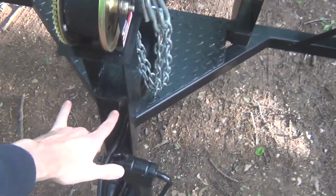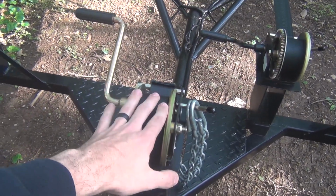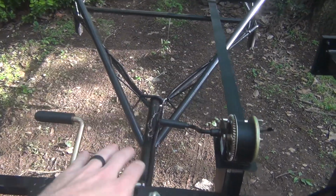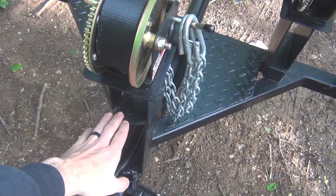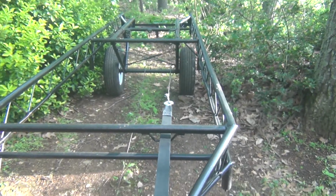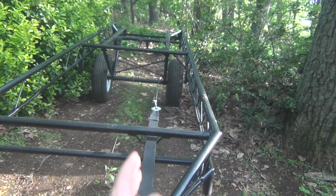We brought this plate up and remounted this winch. Well, it's a new winch, but we mounted this winch here, so that way that's the winch that you use to pull on the bow eyes. Originally, the winch that was sitting here was the winch that we moved over here for actually raising and lowering the center lift trailer. We moved it over so you get a more straight line pull from that last pulley, and it's coming straight down instead of pulling towards the center. Plus, it gets it out of the way of this one.